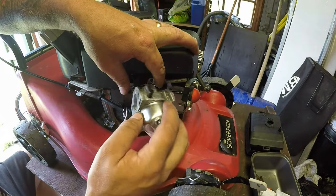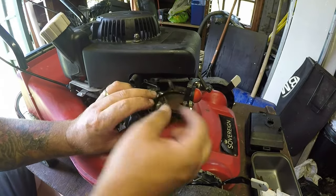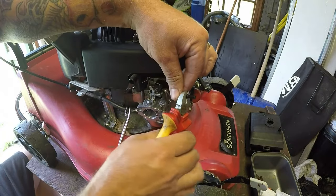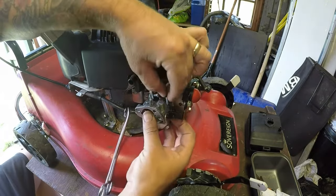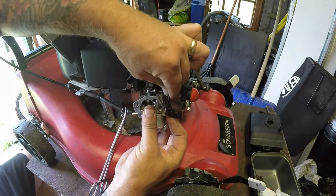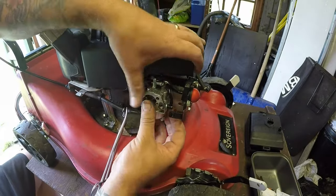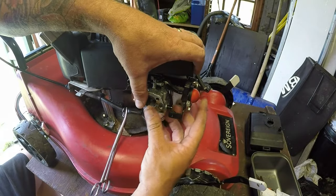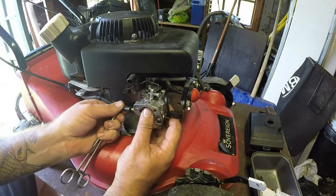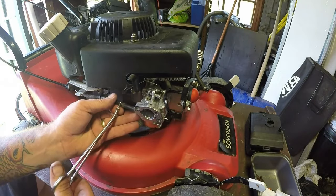I think that was the main issue with this lawnmower, was that it didn't actually have a fuel line. So it's a little bit long, so we can afford to go a bit shorter. That'll go on. That all goes on. Yeah, that's priming. That wasn't before. So now we can hook up the fuel, because you won't be able to get to that once the carburetor is connected.